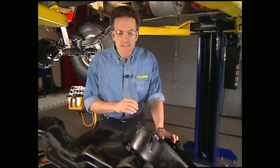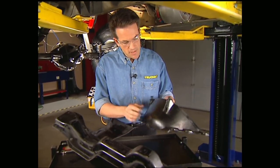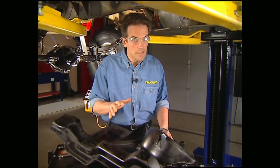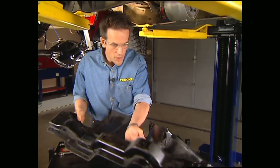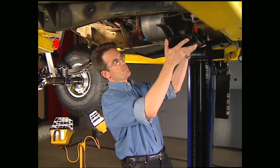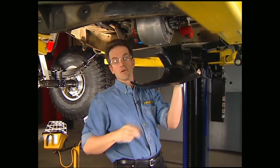We're ready to get the inspection plate and the crossmember into place. Do yourself a huge favor and take a little time to clean and paint these parts, because it makes completing the project a lot less messy. At this point, all you're going to do is loosely bolt the crossmember into place, because you may need to move things around a bit when you do your final hookups.